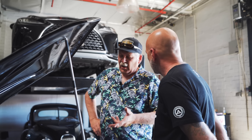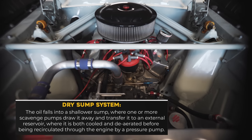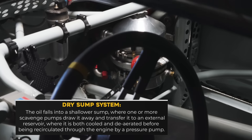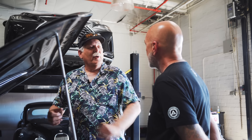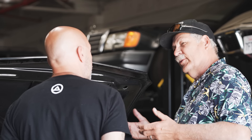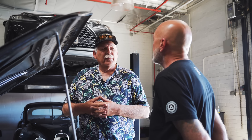What is the engine? It's an all-aluminum dry sump 363. Dry sump is basically an engine with a vacuum cleaner in it. It removes the oil with three fittings in the oil pan and one under the carburetor. When the engine's spinning, there's no oil on any of the moving parts within reason, because it's creating 11 inches of vacuum and sucking all the oil off — which in turn wears out quicker because the piston rings don't have much oil on them, but that makes more power. It's a timed engine that doesn't need to last that long. I'd say 100 hours is already at the limit.